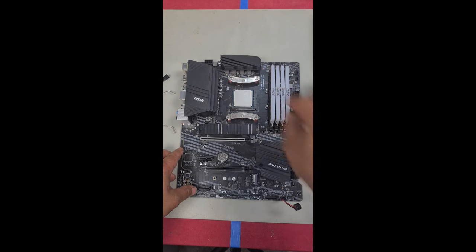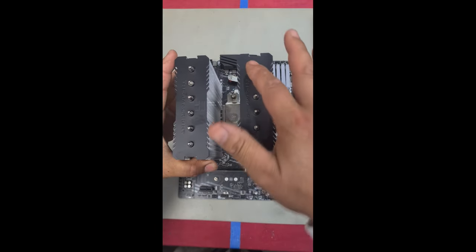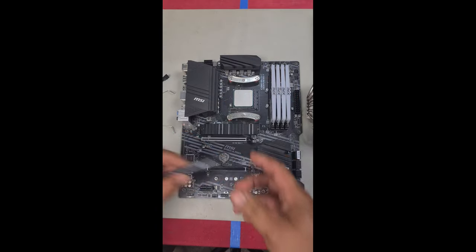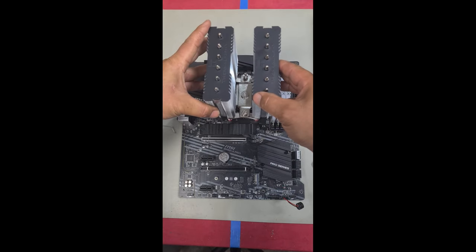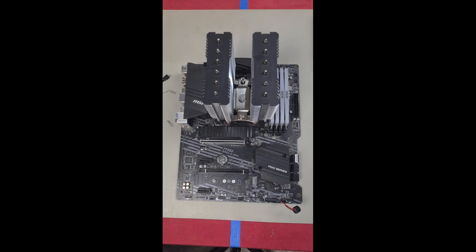To install your cooler, remove the warning sticker on the base, nice and gently. Have your Thermal-Rite logo whichever way you choose — it doesn't matter which way it goes on, but let's follow the way the RAM writing goes. Use the thermal paste they've provided and apply it in an X pattern, which a lot of people are doing now. Grab your tower, line up your screw holes, and tighten — nice and snug, not too tight. And that is our tower on.